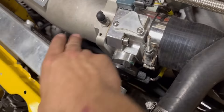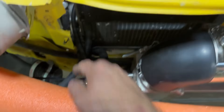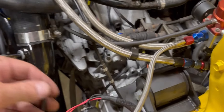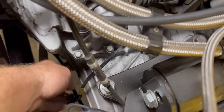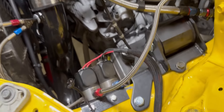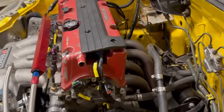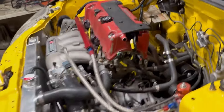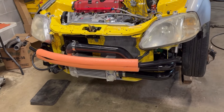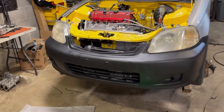Made it to the parts store, got the rubber hose I needed, and got that run. I got the vacuum line — the boost line — run to the wastegates. I didn't have that on before. Started zip-tying things up so everything is out of the way. The speed sensor — I don't have the right clip and I'll have to rewire some things for that, so it's just going to hang out for now. I also put the plug cover on. I think I'm getting close to the point where I need to start fitting the bumper.